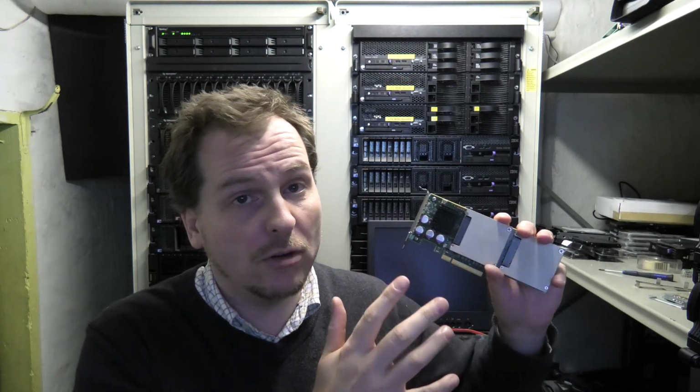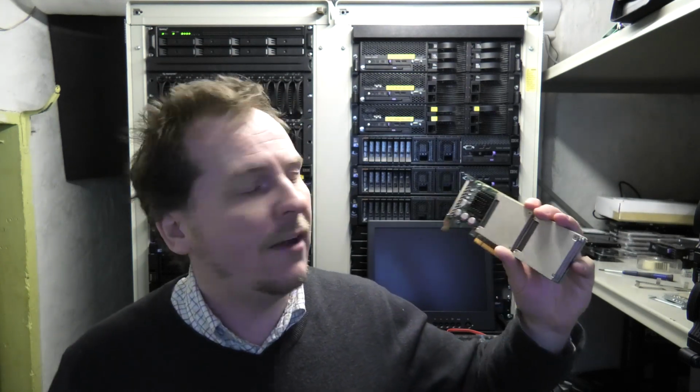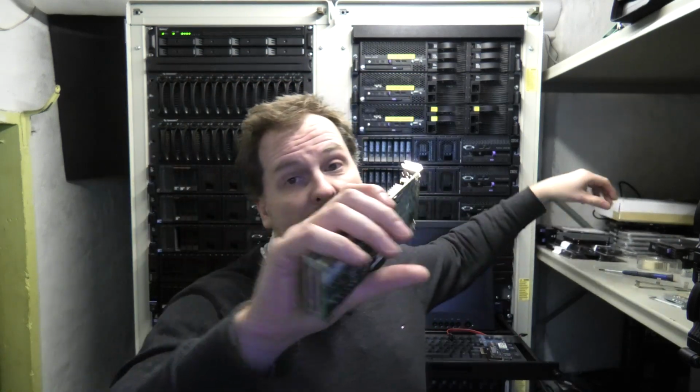Yeah, I don't have any clue right now, but time has probably passed this in regards to how quick it is. There is some endurance in this. You kind of saw that the individual SSD showed up to have 93 gigabytes of storage, so it looks like someone has altered this drive to extend the lifespan instead of having the maximum capacity. This drive might still be very good as a log drive or something where you need a lot of reads and writes over time, where a normal cheap SSD would wear out. Well, and then of course these aren't that cheap. This might last years and years and years instead, because it's still enterprise level equipment, so it should probably last a long time.